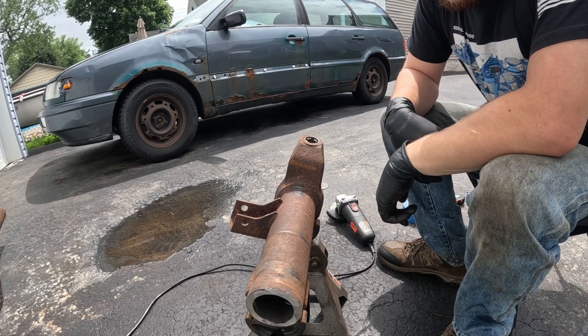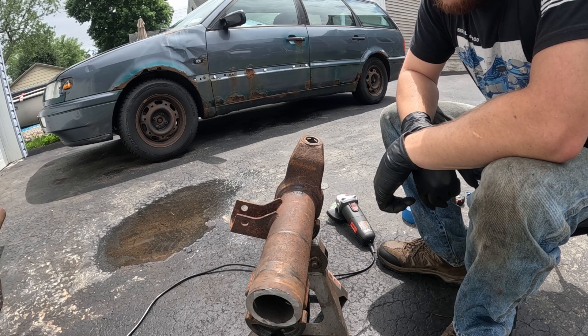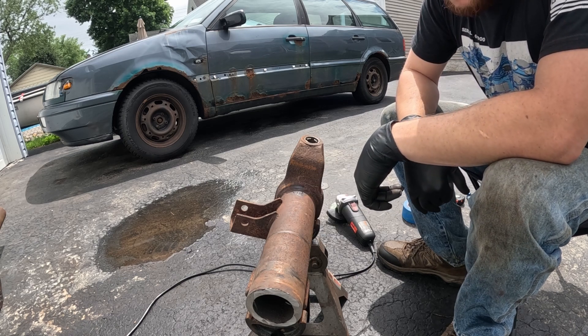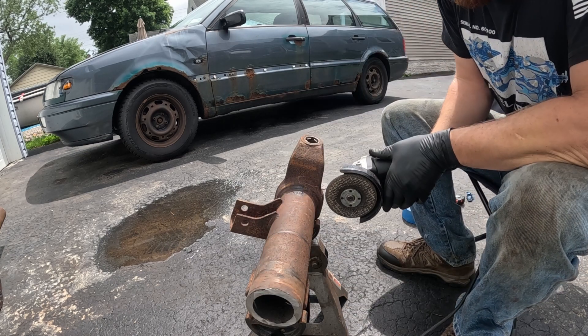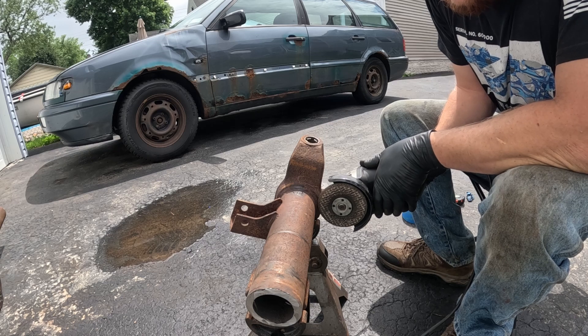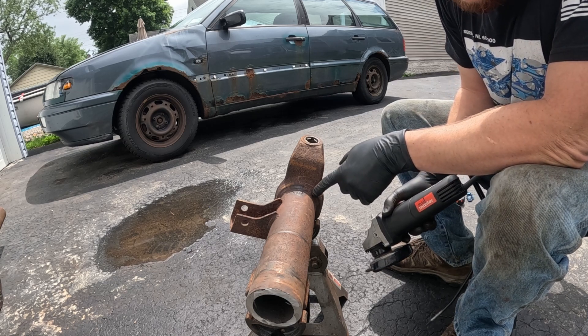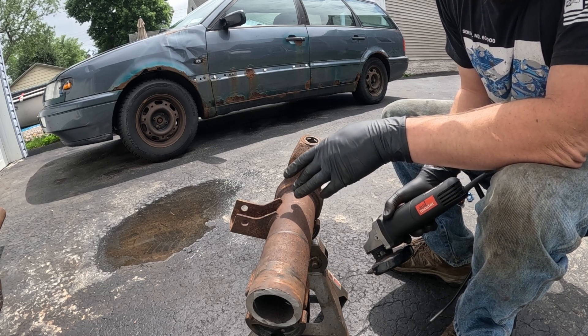The job's not done yet — still got to get this knuckle off. If you didn't shorten it too much it'd be pretty easy to pull out, but doing it this way you're going to have to take the grinder or cut-off wheel and eat away at the weld until we're flush with the knuckle. Then once we've got all this tube off we'll go from there.